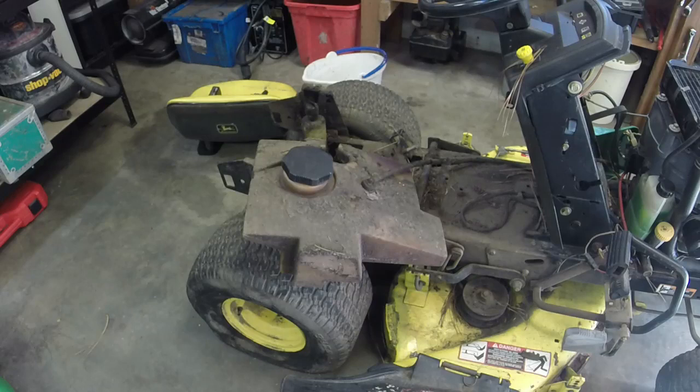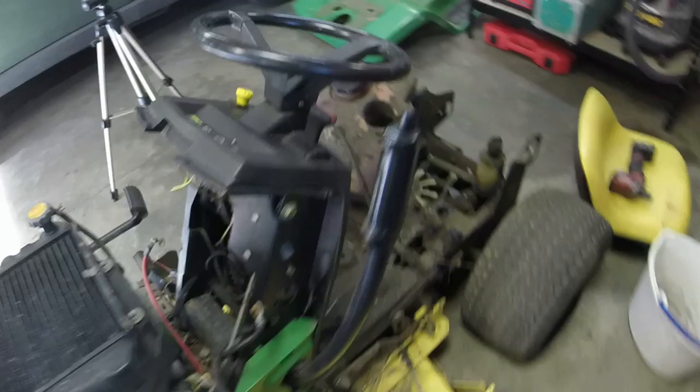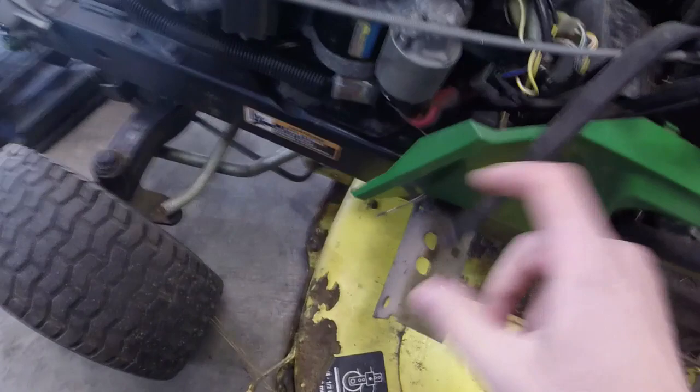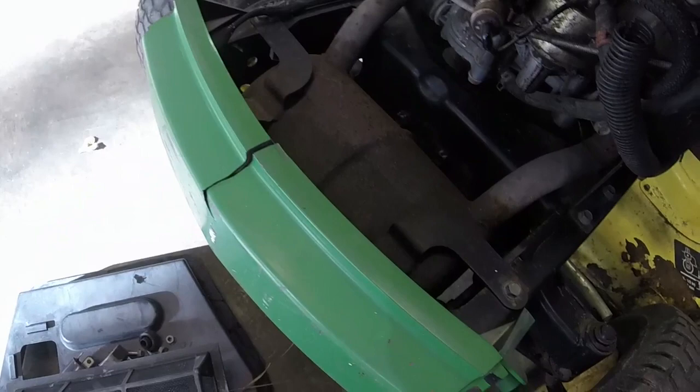Now what needs to happen, let's follow the line along the fuel line here. The fuel line goes up underneath the dash right there, tucks kind of in that area, goes up here and across to a fuel filter, over to the mechanical fuel pump, and then over to the carburetor from there. So that's where we're at.